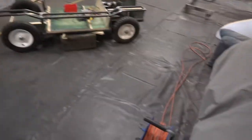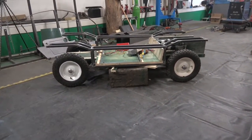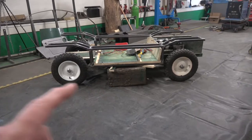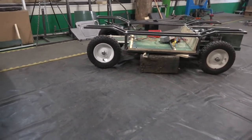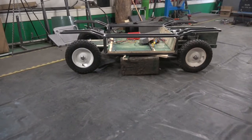So there you go, that's how it's going to look. The idea now is that where you see the frames on the bottom, we will attach them with nuts and bolts to that base plate, and that will make it even stronger because the metal's underneath it. The wheels will be much higher up into the arches — it's only because we've got them on these blocks and they're off the ground at the moment, so there's still quite a bit to come down.